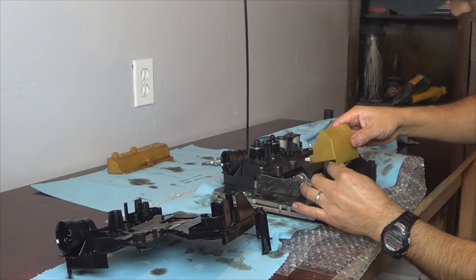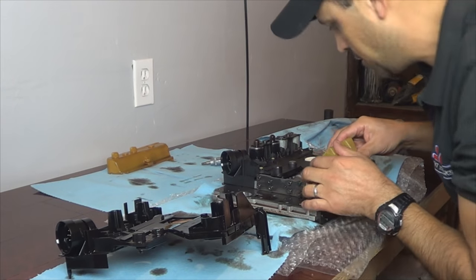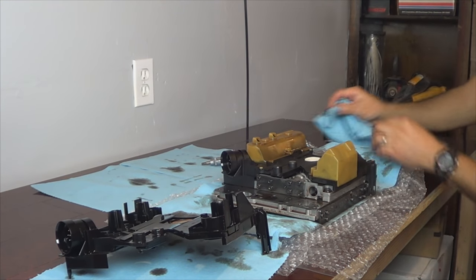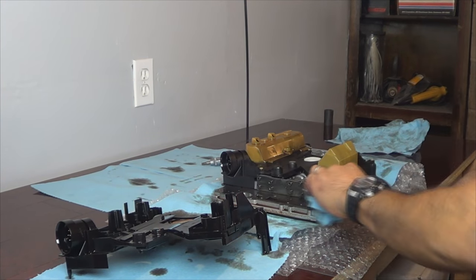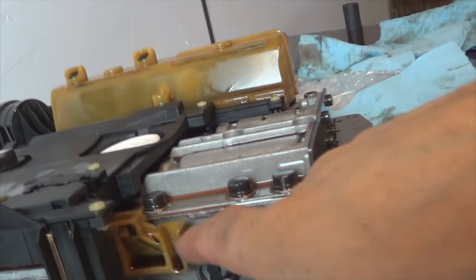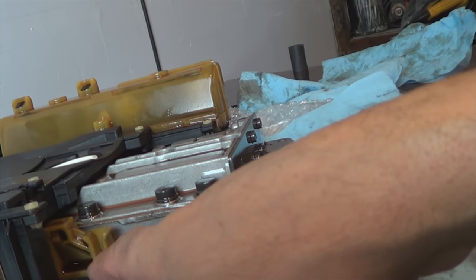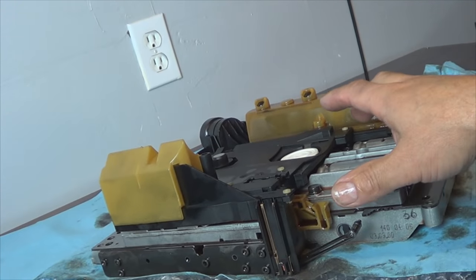The cover's about on. Put the snap in place — just like that — and the other one on. Wipe the mating surface again on both sides and your valve body is ready to be installed. When you install it back on, make sure that the part where the shift rod goes slides in properly, because if it's not aligned it's not going to shift properly and you could break it. Be very careful when installing it and guide it properly. Other than that, this is just going to go back up the same way it came out — straight up — then install the bolts that hold it in place.